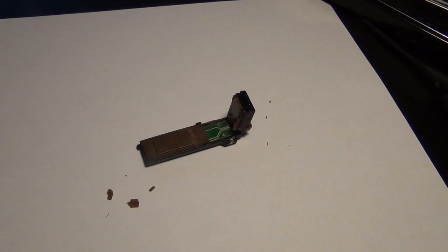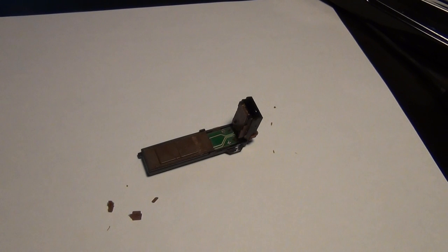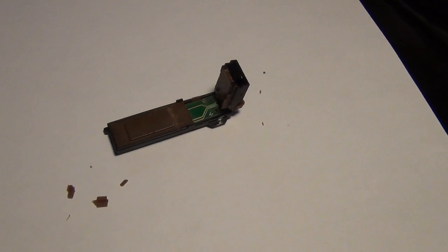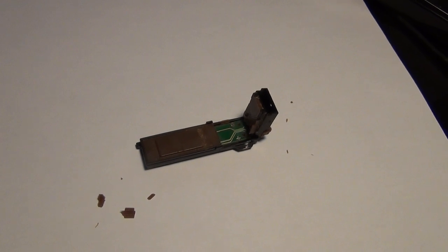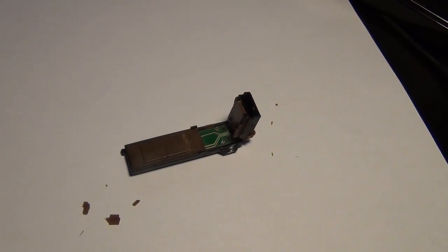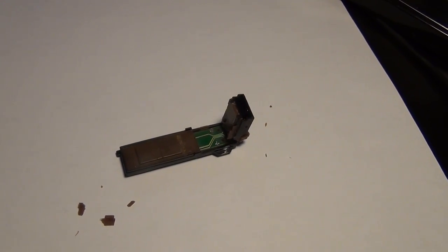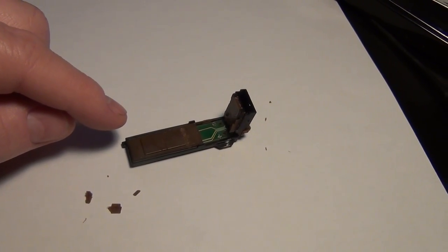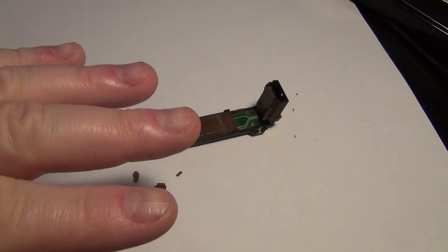That didn't do it. Now the typical no start is the no start, no crank issue, where all the lights in the dash come on, everything looks fine, but then you turn the key to position 3 to turn the starter over, and you don't even hear any clicking or anything. In my case, I just heard the fuel pump going. So the second path of least resistance was one of these new clutch modules or clutch switches, which has four wires that go into it.